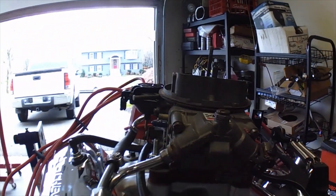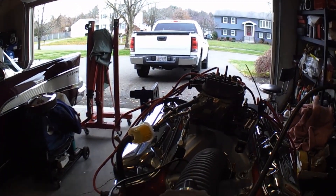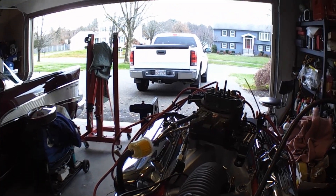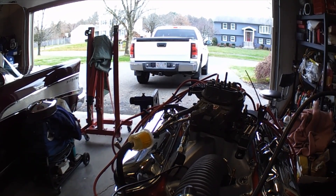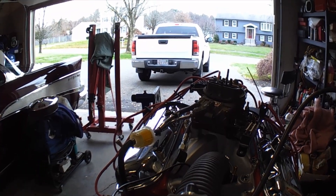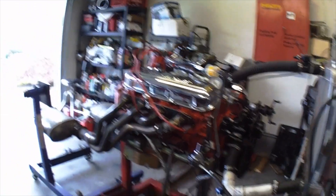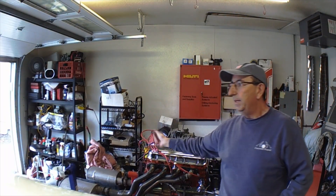So it's a good street motor. Comes with this cool air cleaner, GM factory stock carburetor. Look how cool that intake looks — see the carburetor on there? It's crooked. Why is it crooked? Back in the day they thought it was going to help with jetting the carburetor, because on a big block typically a couple of cylinders went a little lean. So they twisted the carburetor and the intake to try and fix that problem. I think it's super cool looking. Give me a call if you're interested: 413-204-1390. You can call me or text me with any questions.